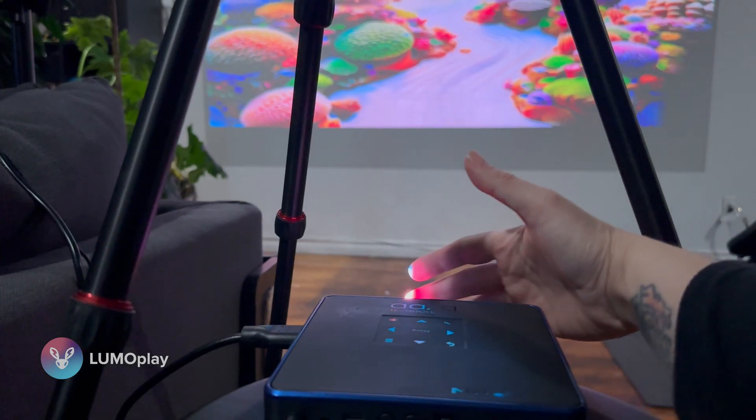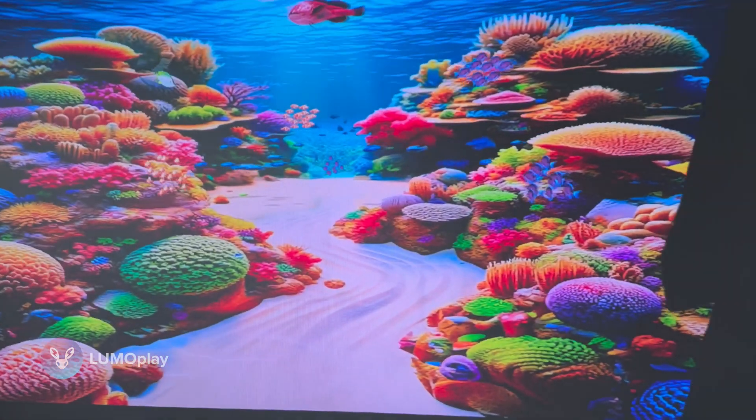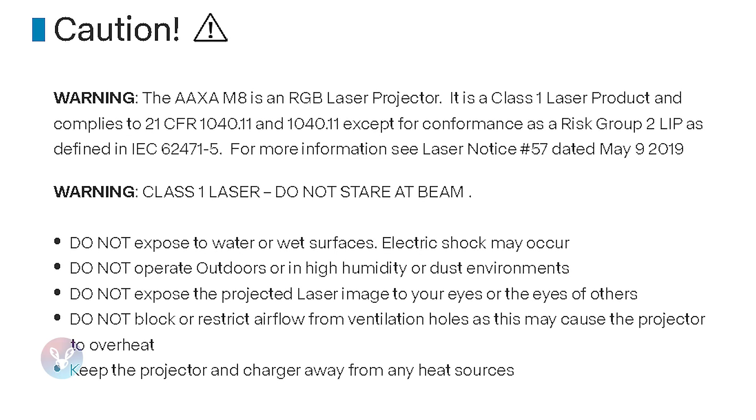With this projector I found the input was reset every time I restarted it. It also has a feature that will trip the bulb any time anything blocks the light — this is a laser safety feature. It can be disabled, but if you were going to use this for an interactive floor or even a wall display, you'd probably have to disable it. I found that even when I was quite far from the projector, it was tripping the sensor if I cast a shadow on the projection. I wouldn't recommend disabling it unless you're really familiar with how to test for light safety, because having a child get beamed in the eyes with this projector for an extended period is liable to do some harm.